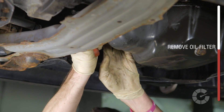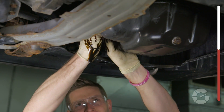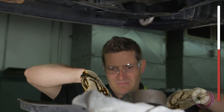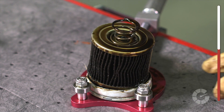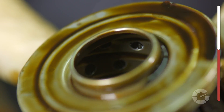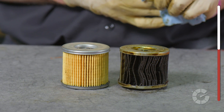Find and remove the old oil filter by hand or with an oil filter wrench if needed. Spin the filter until it comes off in your hand. Gently bring it down without tipping as it'll be full of oil. Make sure to have the catch can under the filter as oil will spill — it can get pretty messy. This is what the inside of a used oil filter looks like: tiny pieces of metal shavings from parts rubbing against each other accumulate in the oil but are filtered here to avoid reintroducing them into the engine.